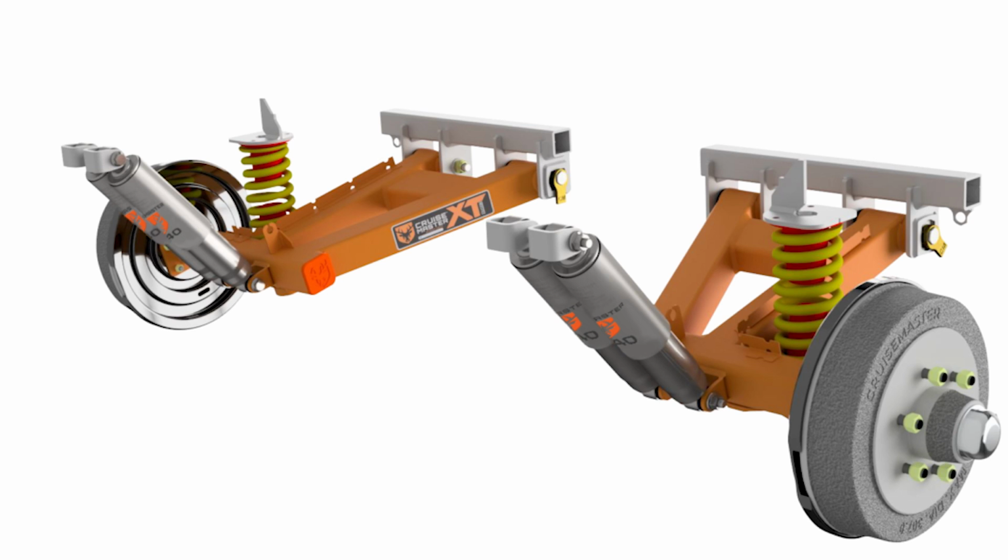You'll have a mount on that arm for an airbag or a coil spring. You'll also have a top mount for that airbag or top spring. All of that, they generally give you all the bits you need ready to weld in. They'll give you all the measurements that you need, and they're a really good setup. You'll also have a shock or two that hangs off them. A lot of them have two shocks. I don't know why, because one's probably all that's needed.